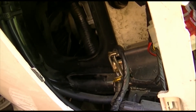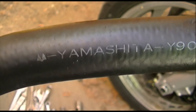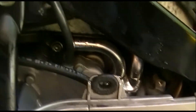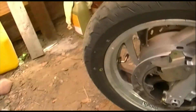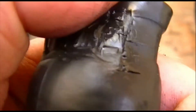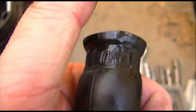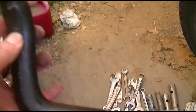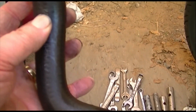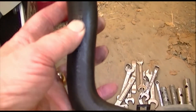Yamashita sprung a leak. Here's the culprit — this tube that goes from the water pump over to the water jackets in the front cylinder. There's the leak right there — that's a pretty good one. This is a formed tube, so I guess we'll try to buy one if we can. If not, we'll try to fit a piece of conventional tubing in there, but I think it'll probably try to kink right there if we don't get a formed one.